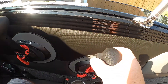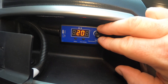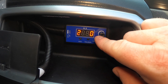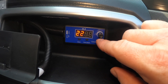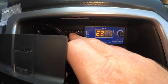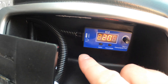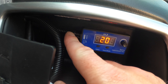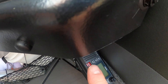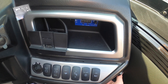Obviously you still have to put the kicker motor in gear when it's running, and then you can make very fine-tuned throttle adjustments with this little knob right here. These servo testers are very cheap — I actually bought two to keep one as a spare. The top connection is for your positive and negative six volt power supply, and I put a little switch down underneath the dash so I can turn it off and on just like that.